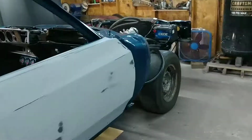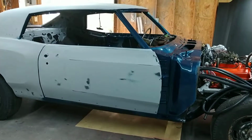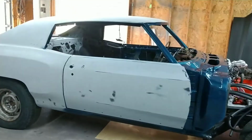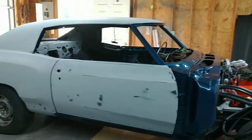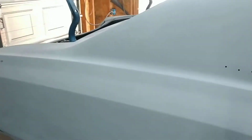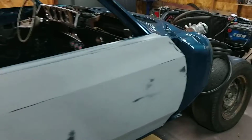Okay, so what's going to happen here in the next few weeks is we're going to be getting down to the nitty-gritty of things. Once Cowboy, Mr. Windshield, comes and puts the new front windshield in and the original back glass, which actually cleaned up pretty nice, with the clips, urethane, foam dam kit, all that stuff. You always want to use a foam dam kit, not just urethane. That's the way the factory did it. He puts it in the way the factory did.